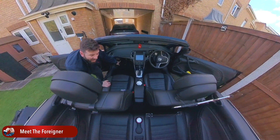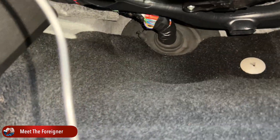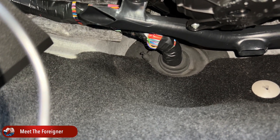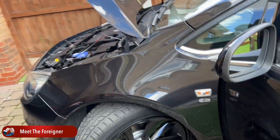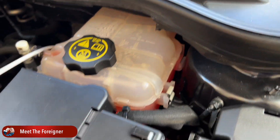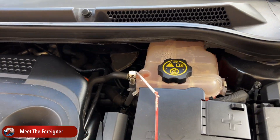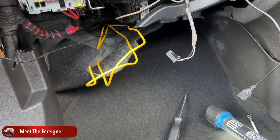Found the grommet right there. And there is the grommet right there. We will have to try and route two more cables through the same hole. I've inserted this wired cable through the grommet. I'm going to put it on the other side and thread it through here. And now we're going to hook these two cable ends and pull them through the grommet back end.